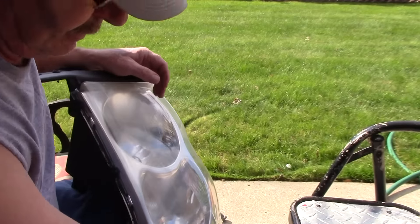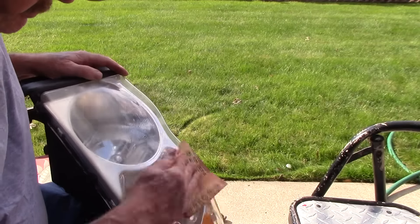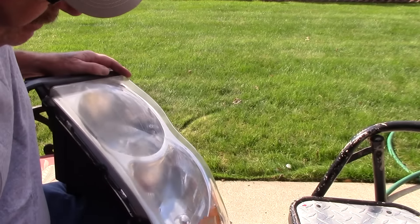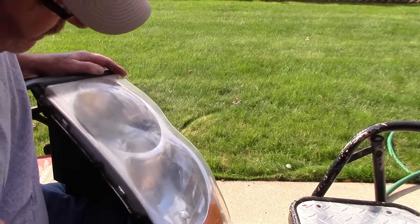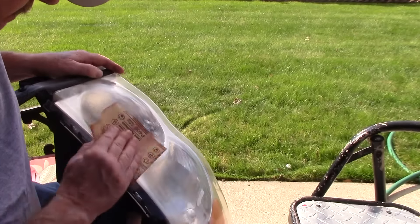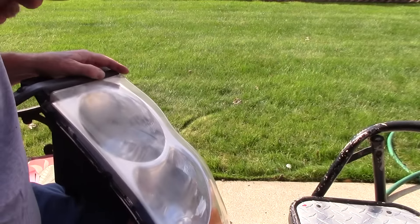When I water sand, I usually let the paper soak for a while, and I only go in a one-way motion — I don't do circles. You can more or less see it's starting to come off already. It takes a little while to get the whole thing nice and smooth. You've got to cut down that one layer of plastic — it takes a little bit of water sanding. Then I rinse it off to see if I'm satisfied. I'll show you when I get done with this, so it won't be too long of a video.